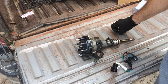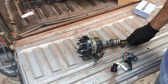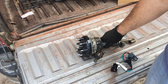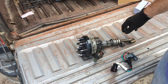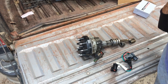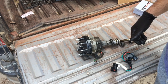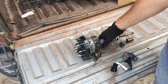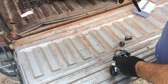I didn't see any videos on YouTube about changing the pickup coil in a Ford distributor. There are many people that have this problem on a Ford vehicle — F-150s, Broncos and such — where there's a hesitation, a stutter in the driving, in the firing, and there may even be misses. It sounds like misses in the firing order. A typical fix people will tell you to do is change the pickup coil, which is inside the distributor.